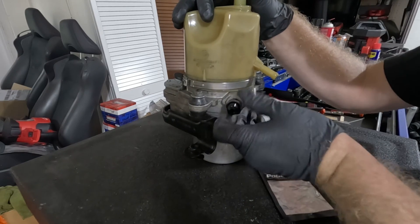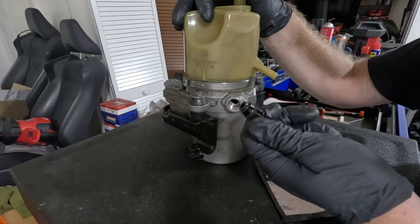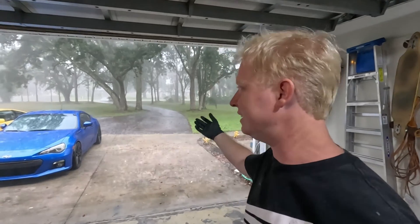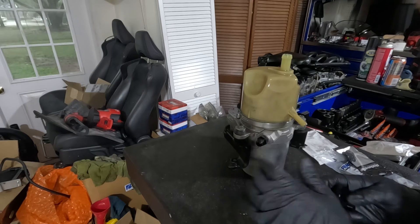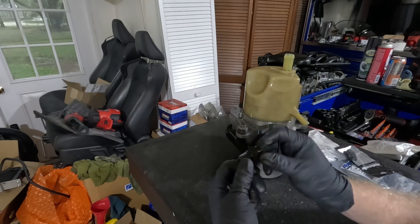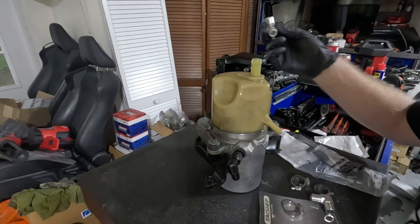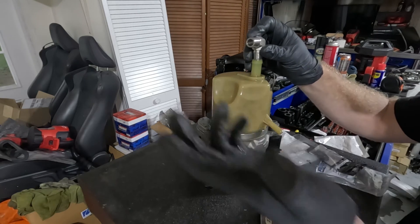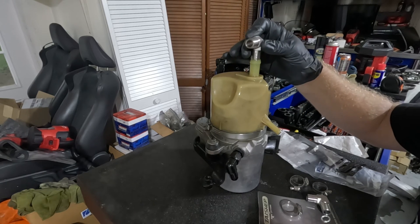With O-ring fittings, when you screw them down and get to the O-ring part where it seals, you can really feel the O-ring seating into place. Pardon the noise today — it's pouring rain right now. I have one more fitting: a 90-degree female-to-male 6AN fitting that swivels so we can spin it whatever way we want. For the 5/8ths line, I'll run it in here. For this other port, instead of bending the hose 90 degrees and risking a kink, I got a stainless steel 90-degree fitting.